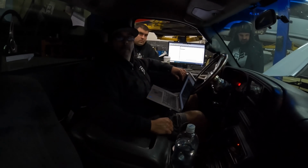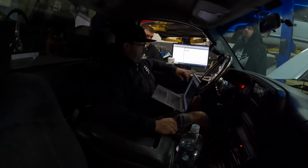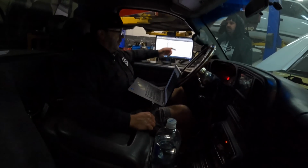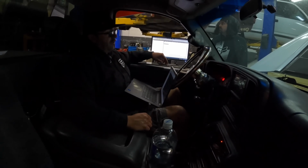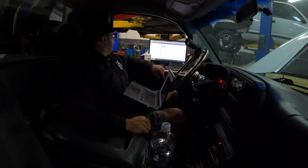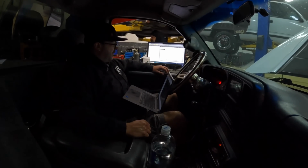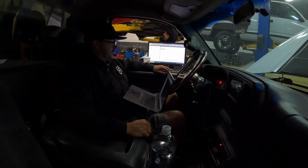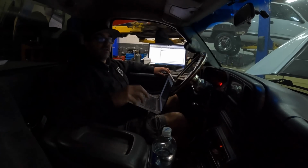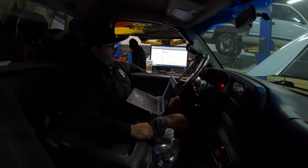Remember, I literally said I felt like the converter wasn't fully locking before, so that explains the feeling I was having. So I unlocked the converter. I did a pull, and it was the same. I locked it in the tune, and it was the same. And then I manually locked it, and it was the same. So the converter is definitely slipping, but it was unlocked, so it's gonna slip some. But I don't even know if that's converter slip. It feels almost like the transmission, the way it's unloading and loading. So, I had the trans builder up.